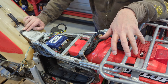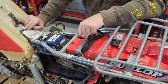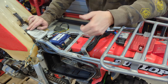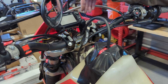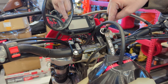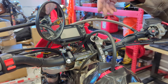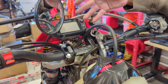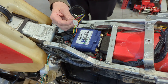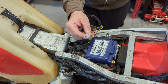So that's your hookup for the charging system: stator to regulator, regulator to battery, then plug in your new CDI box. The one other thing that matters is you have to switch the power to the CDI box, since it's now battery-powered rather than magneto-powered by kicking the bike over. If you run a dual sport kit like this bike — I'm running an old Baja Designs kit with a key switch — you can switch battery power off that key switch through your entire harness. The Tusk harness and Baja Designs harness both have a DC circuit for this. Or you can add your own key switch or any on/off switch on the handlebars or wherever you'd like. The red wire on either our CDI or the Ignitech CDI needs to be switched — you don't want to leave it hot all the time. Make sure you can turn it off when not using the bike and turn it on to supply 12-volt power to the CDI when you're ready to ride.